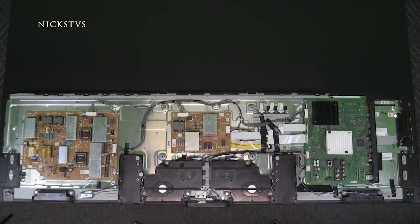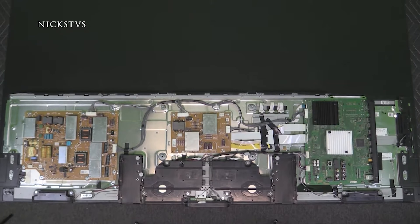8 blinks, according to Sony, is a software error. We've never actually seen one of these main boards with an 8-blink error code, but we have seen hundreds with software issues without triggering 8 blinks. If you're experiencing a software failure, that's something our mail-in repair service covers — you can find the listing linked in the description. The remaining symptoms we'll cover are also main board related but don't cause any blinking codes because the board can't identify itself as defective.